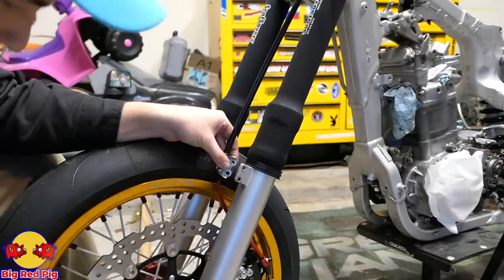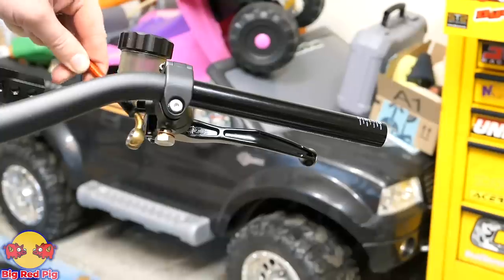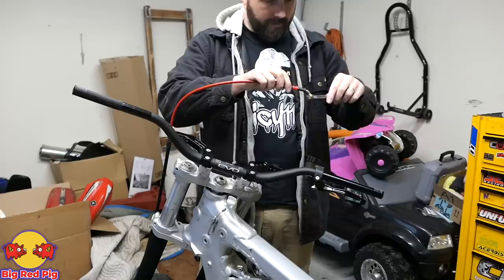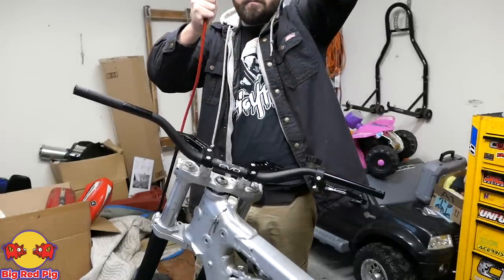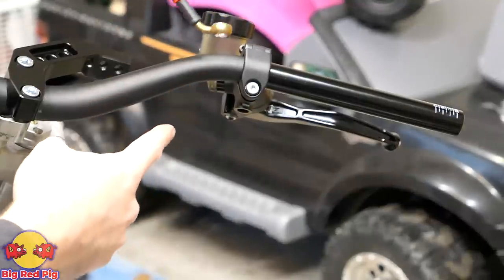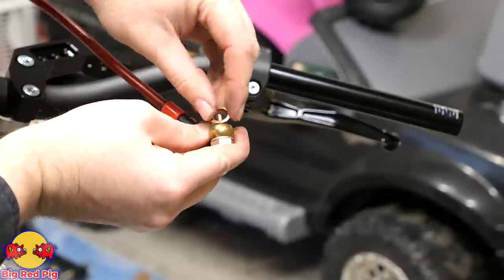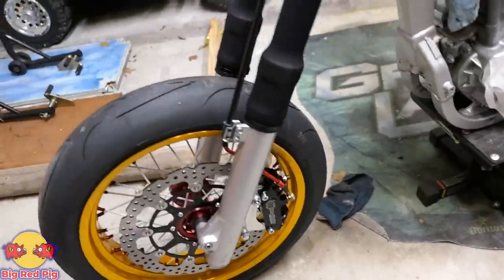A lot of things to line up now. The brake line needs to come up and attach. There's this kink in the brake line that, once flipped the other way, would actually be really helpful to us, but currently it's completely the other way around. These banjos are adjustable — the industry secret tool for adjusting them is these very special plastic pens. What you do is flex the whole thing one way or another and they'll turn, and the plastic won't mar anything up. I think I can do it with it on the bike right now since the bottom end is clamped. I know this was definitely meant for a different type of master cylinder, but this is actually working out really well. I think having that extra two inches added was a really good idea. The routing of the brake line is looking pretty good.